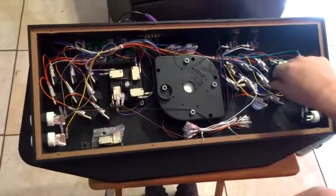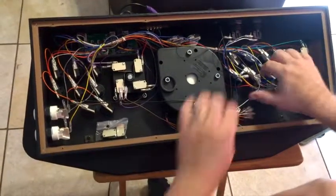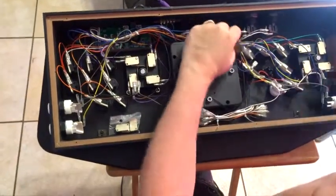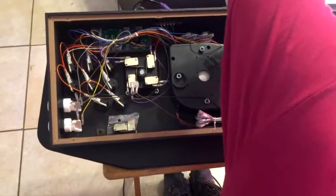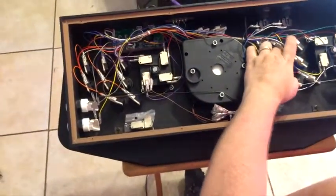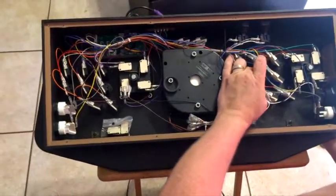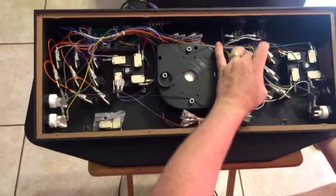as such. So next in line, if you will, next to my blue comes my red. So again, I start at the top here. I just kind of pull it back, rock the micro switch out of the way, hold it from the bottom so it's not spinning, and unscrew the nut. This should be just hand tightened, so you should not need any wrenches or tools. You're much more likely to damage something if you start pulling in pliers in here. You really shouldn't need them. These are all plastic pieces, so they come right off as such.